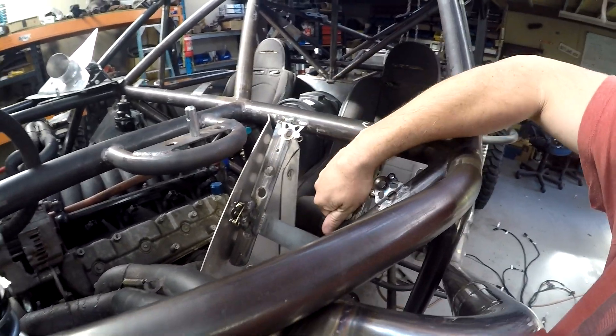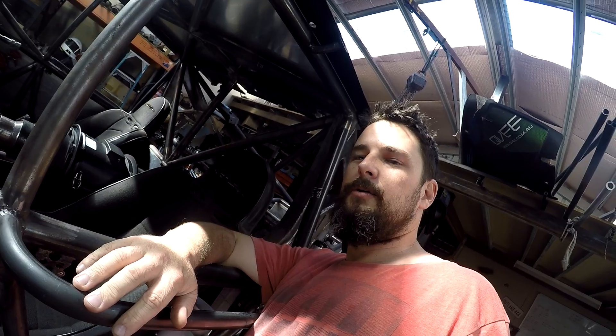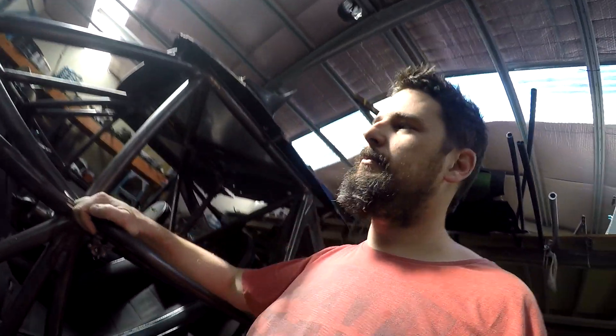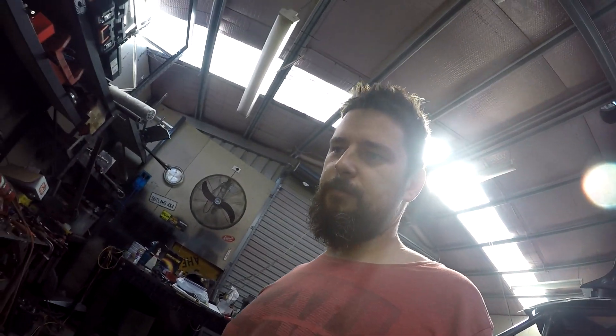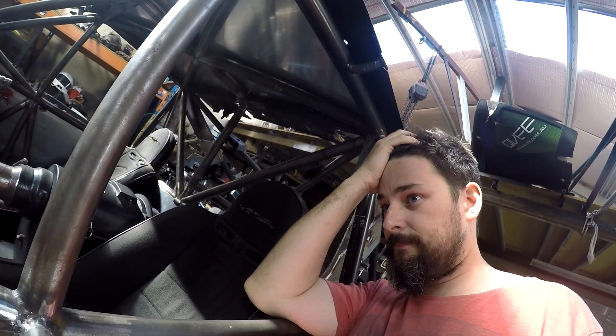It's something we just need to be aware of. Although all this gets panelled in at the back here, I'm still thinking we need to build another box. You'll be as careful as you can be when you're cleaning your car after an event, but it'll be that one time and you'll forget about something, you'll be talking to someone, and you'll high pressure hose your ECU. We don't want that. I think it's pretty well sealed, but I don't think it's designed for off-road racing — it's actually designed for a drag strip. They use these in the top fuel race cars. I'm still trying to work out how I'm going to mount it in there because it's tight, and the loom is quite stiff, which doesn't help things.